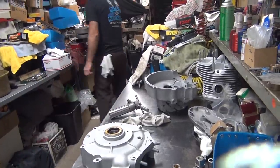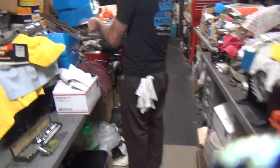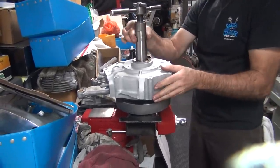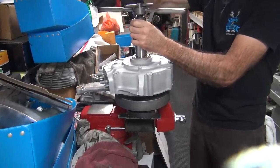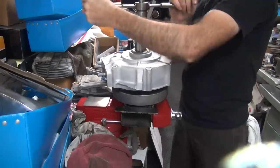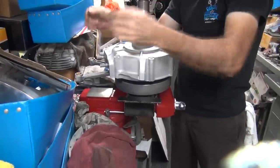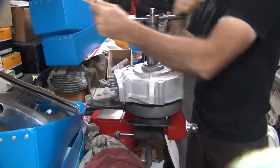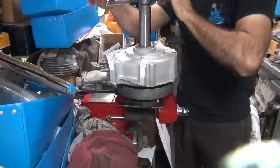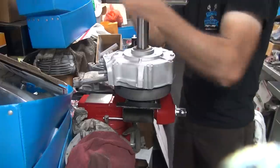Where's the spacer? Don't forget the spacer — very important. Make sure rods are in the hole. On these small bore motors, two don't fit in one. But on new bikes with the big bores, they do. You can create a situation where you realize, oh no. The biggest problem is when it gets stuck under there and you keep going tighter and tighter — it bends things up a little bit, moves the rod around, knocks the crank out of true, and bends the rod slightly. It usually requires more work.